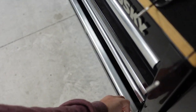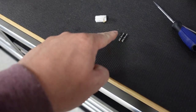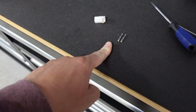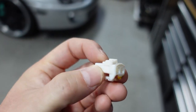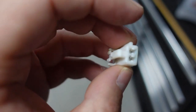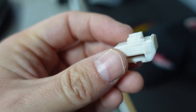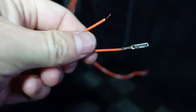The nice thing is I don't need to run any new wires because they're already inside the car, but I do have to get in the car upside down and try to pin this, which is never fun. One thing to mention when de-pinning: you have to undo the locks on top first — you de-pin from the front side, push up and out of the lock, but you have to pull the lock out first. Sometimes it doesn't want to come undone, so be aware of that.